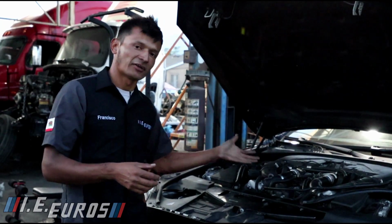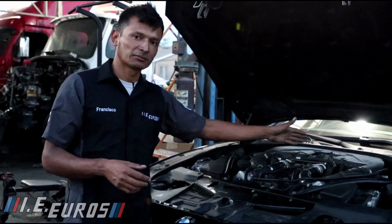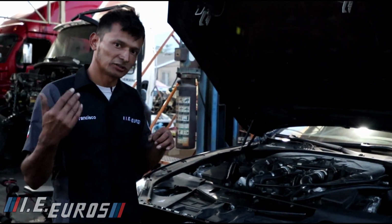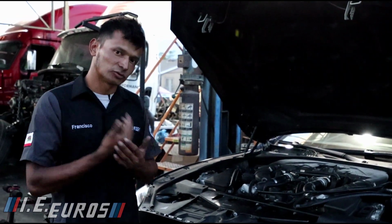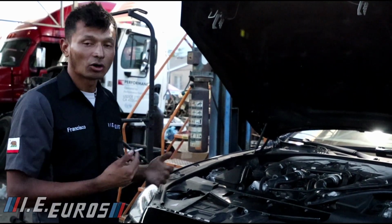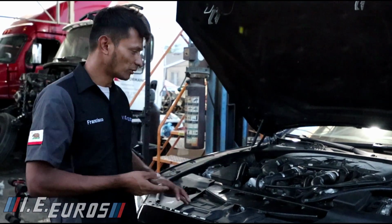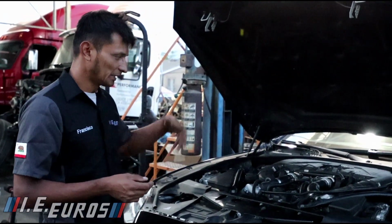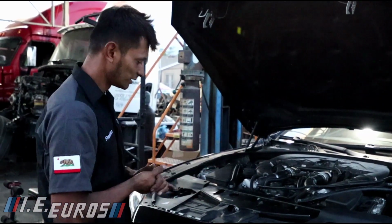Car didn't have any power at all because the turbo on this side wasn't getting activated because the wastegate is always opened, so the turbo pressure was leaking out as soon as you start the engine. And as soon as you start pushing the power with the accelerator, there was no power because of the boost pressure leaked out. So there was no boost pressure getting built up, and this is the reason why the car didn't have any power. Luckily, this car is ready and is fixed.